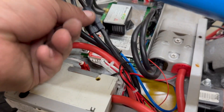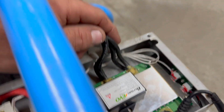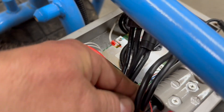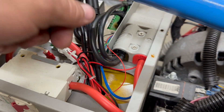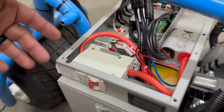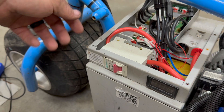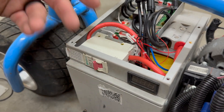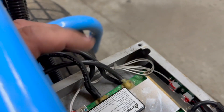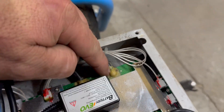The battery cells are running four 10-gauge cables negative into the BMS. Looks like we're running two 8-gauge cables out going into the Anderson connector. This looks to be about a 4-gauge cable. This battery is only 48 volts, 30 amp-hours, and with this little contraption we've been getting about 15 miles of runtime out of it. We're going to try to check the voltage here.